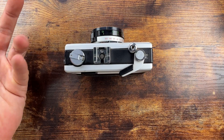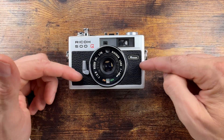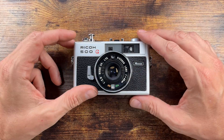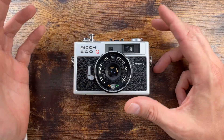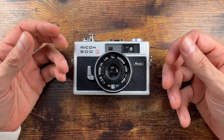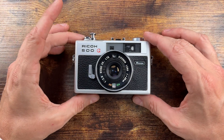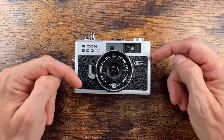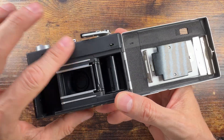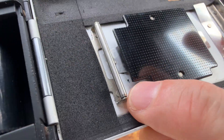Overall, this is a pretty cool compact camera. It's inexpensive — if you want to start dipping your toes into film photography, 35mm is the way to start and getting one of these is not going to break the bank. It's a fully mechanical leaf shutter rangefinder with shutter priority, a meter, filter compatibility, and flash support. If you're evaluating one, verify the rangefinder alignment, verify the shutter speed, check the meter response with your battery workaround, and most importantly check the light seals — the ones on mine were very bad, rotten, gummy and crumbling. I removed them with alcohol and Q-tips, and cut new strips from neoprene foam.